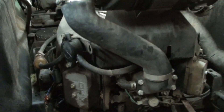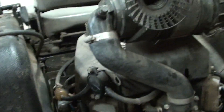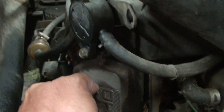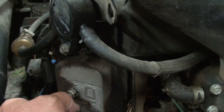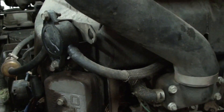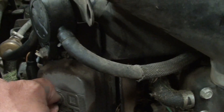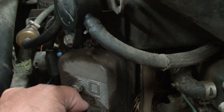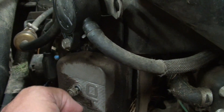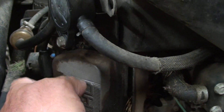Here's today's debacle. Got the mower over and it started running on one cylinder. We changed the spark plug and it still ran on one cylinder. I pulled the plug out, held it against the block, turned the motor over and had plenty of spark. I put my finger over the spark plug hole and turned it over — I had zero compression, or very, very little. Not enough to start or fire it.